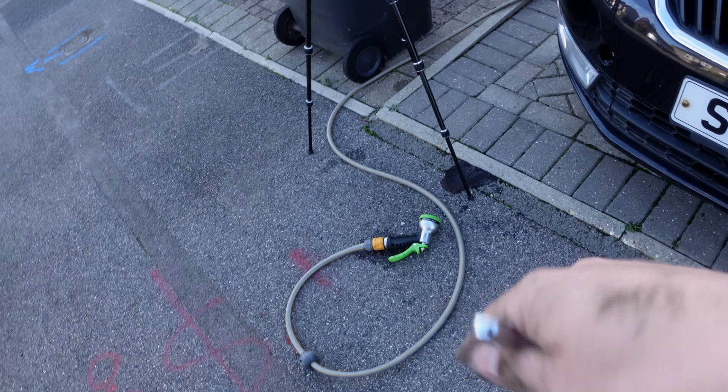Welcome back guys, it's another day and welcome to my paint booth. So let me quickly show you around. Obviously the bonnet is here. I'm doing the inside first because I want to paint the inside and then do the outside. I want to do the bit that everyone's going to see last. So I have masked the whole edge and I've sort of overlapped it over the edge so that I don't get a build up on the edge when I do both sides.